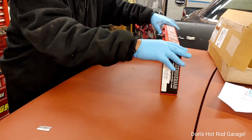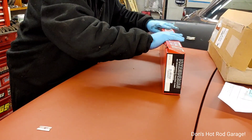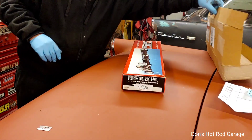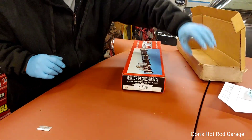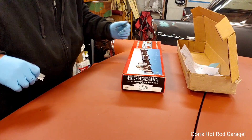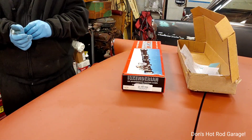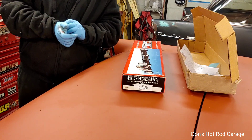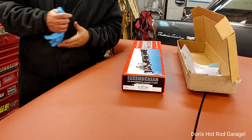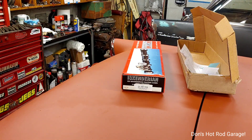Everything's looking good. I just want to double check to make sure that rear journal slot doesn't have to be as deep — it's probably about half as deep as the original one. We'll double check that; maybe Bob even knows if it's going to make a difference. Because as far as I know, that notch in the back cam journal just lets the oil pulsate from the rear cam bearing into your rear lifters.